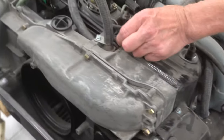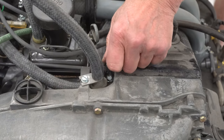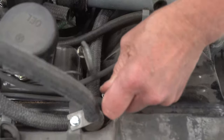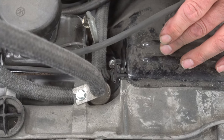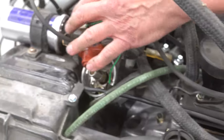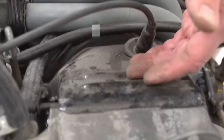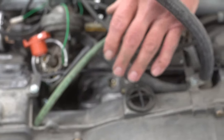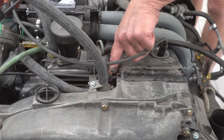Finally, the thermostat bellows, which is extremely important to engine cooling and warm-up. We want the engine to warm up as quickly as possible so we don't have a lot of condensation in it which wears the engine out. This thermostat bellows is up underneath and it pulls the flap shut to not let air go over the oil cooler and to not let air go over that cylinder when cold. When it's open, the flap will go over the oil cooler so that half the air goes over the cylinder and the other half is forced through the oil cooler. If you remove these there will be no air forced into the oil cooler and the engine will cook — people think taking the flaps off helps cooling but it doesn't; it'll cook the engine.